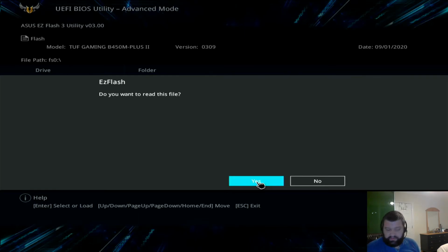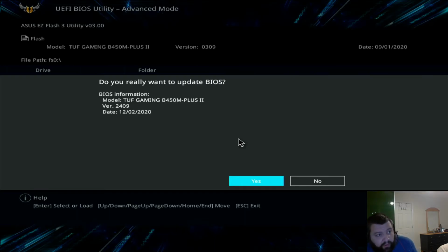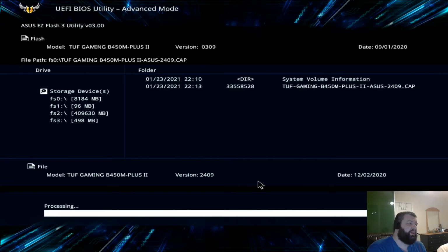This is going to take a little while. Do you really want to update the BIOS? I certainly do. So we're going to go ahead and press yes. And there's a progress bar. This is very important. This process should not be interrupted. If you get a power failure while this is processing, this will essentially brick your board.